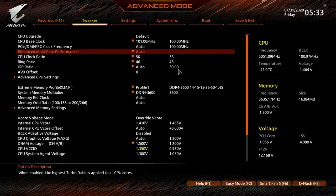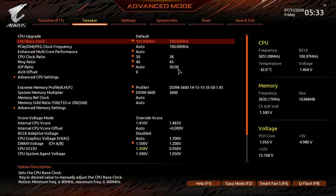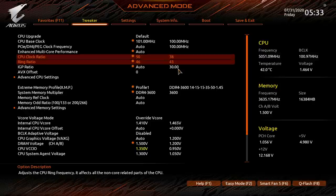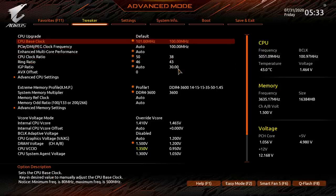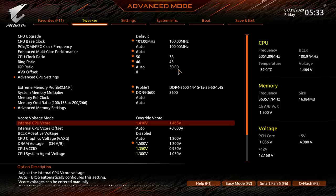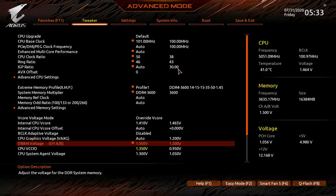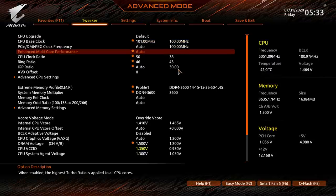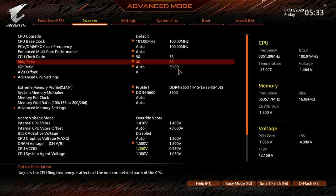Motherboard compatibility issues — the XMP profiles on kits rated above 4000 are not exactly reliable. Most people don't want to go right off into the deep end with memory overclocking on potentially their first memory kit, which is where something like this, being a 3600 CL14 kit, has a huge advantage: it is really fast out of the box but you can also overclock it to be significantly faster. This will actually overclock similar to the 4400 CL19 kits I have in my collection. So here's the overclock I already have on the 10700K — it's just 5.05GHz. The memory voltage is already bumped up to 1.5 volts because I'm running that 101MHz BCLK, so the kit has a 1% memory overclock on it already.